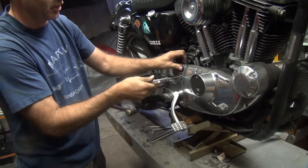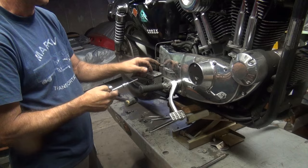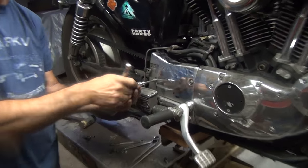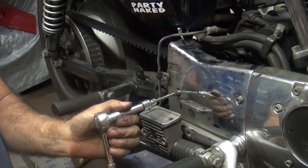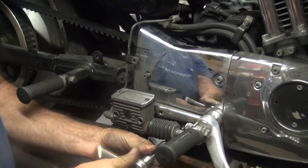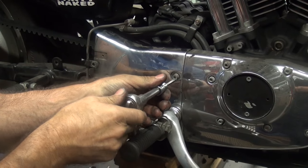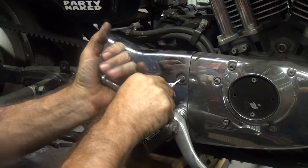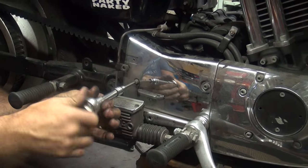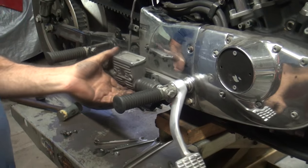See, I know this goes into a hollow dowel, so that means it's going to have to be longer to go in there. This probably goes to a bolt that comes off the motor mount back there, so it's probably pretty short. So that's why I went with the intermediate length here. And this one here goes right in the case, so I know it's only the thickness of the cover. So that's why I had to guess. But as you can tell, it doesn't take too much to figure it out just by sticking the hole. Even you could probably figure that out at some point.